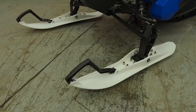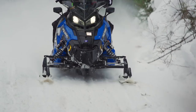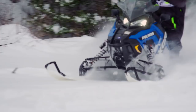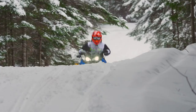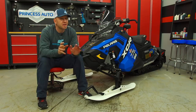Carbides can also be staggered with an optional raised outer carbide to help on-trail steering, or opt for both the same. With two flat pressure zones on the ski's hull and an elevated tail section, the Stealth is designed to erase its carbide tracks while still allowing easy backing up. The off-trail flotation is incredible with the 7-inch width, and the on-trail drivability was very acceptable considering the off-trail performance it delivers. Every sled has unique handling characteristics — when it comes to your skis and carbide runners, you can fine-tune your sled's ride to your riding style. And with Kimpex, you don't have to break the budget.